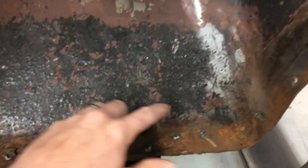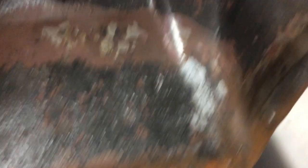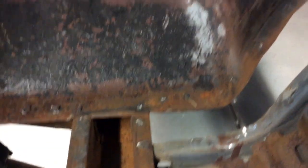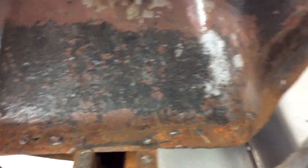On this driver side, you can see it's a little strange that it went high on the inside, which is not as common. Usually they're rotted out more the whole way up on the side where the rocker is. But you can see the pinholes going up there. I cleaned the line going across there, so I'll cut that toe board out and patch it in place. You can see it's just pitted and rusted along that whole bottom lip there — we'll cut that out and get that spot changed out.